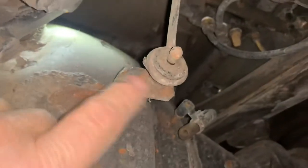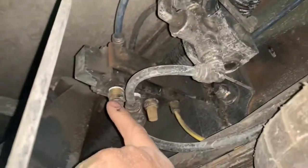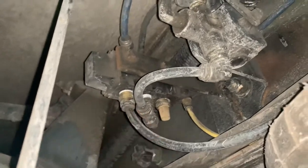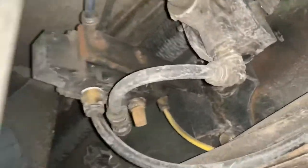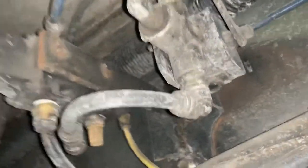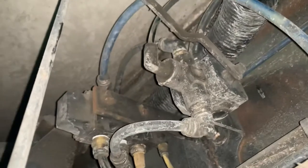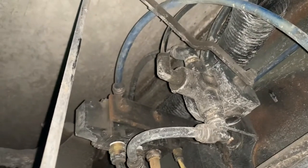This is your auto ride valve. You've got the rod — it comes down, connects to the differential. That supply I split, I ran it through the regulator and over to the over-inflate valve, which I just bolted a bracket on and welded. I think I welded off that same bracket that holds the dump valve or auto level valve.